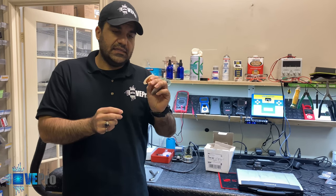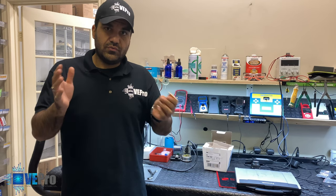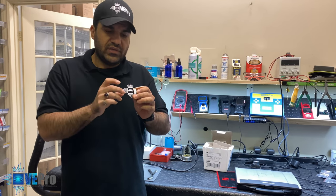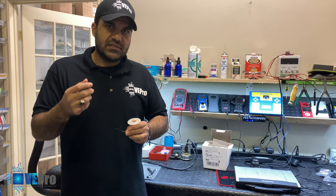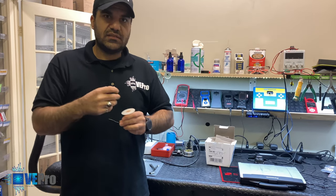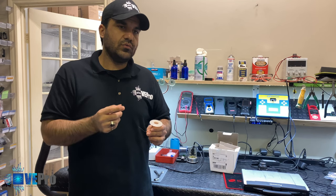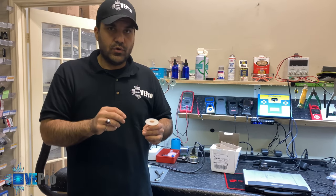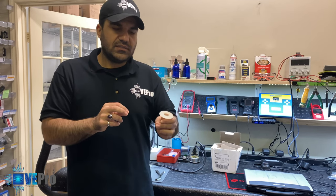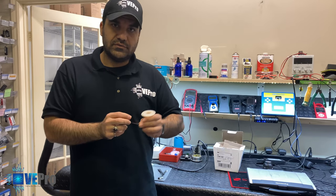And what we do is we run this through the points between the two through holes, and you can see in the video, we solder on both ends to create a new connection. And so sometimes what happens is, if the through hole is actually eaten away so much that you can't solder onto that point, you would trace that through hole to the connection point that's going to, whether it's a component or another test point on the board, and you would solder this onto there, creating a connection. And so that's what we did, and that's what we'll show you in the video, how it's done.